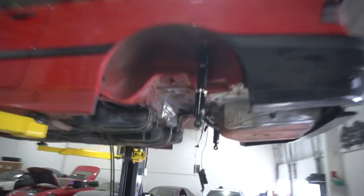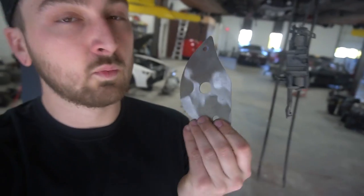We're gonna get right to the part of this build that I was dreading the most, and that is reinforcing the whole rear of the E36. Once these cars start making decent power they tend to just rip the subframe mounts right off the chassis. Well this thing never made decent power and it already started to destroy itself. So what we're gonna do today is take plates like these and weld them straight to the chassis, give it some more strength and never have to worry about it again. It's not hard, it's just tedious, dirty, and not that fun.